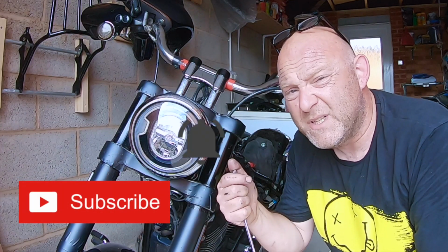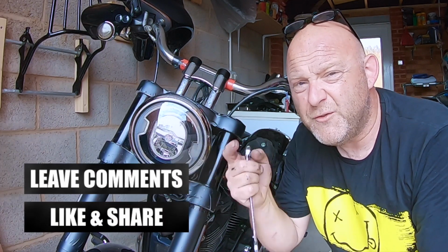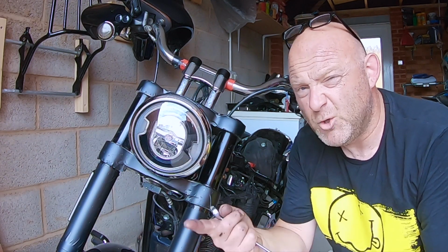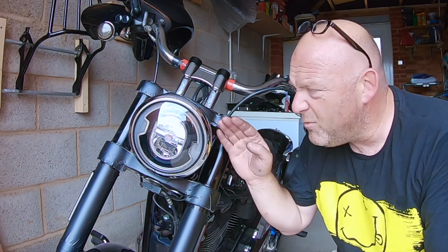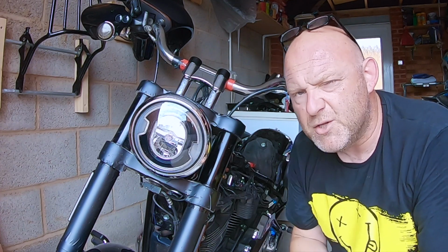So these need to be torqued down now. Basically you need to torque them down to 40.7 to 54.3 Newton meters, or 30 to 40 foot-pounds of torque. Your choice. Now, to get the torque wrench under there, you're possibly going to have to loosen the headlight bracket, move it forward slightly, and get your torque wrench under there. But I'll let you sort that out.